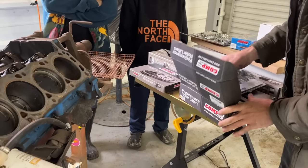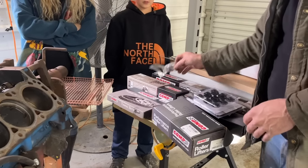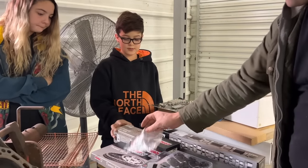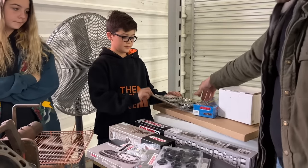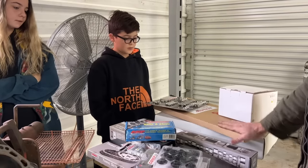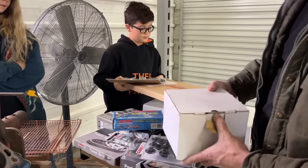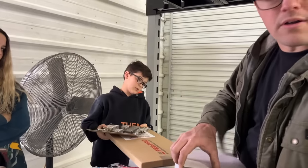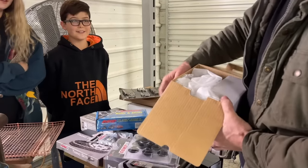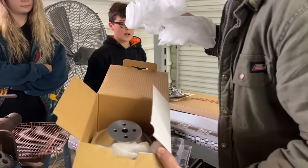All these parts, I will have the part numbers in the description. We also have a timing set, retainers and locks for this thing. We got a new set of valve springs. We have push rods for it. I went ahead and got a bolt kit for it too, new ARP head bolts. We got a gasket set. I got some pulleys from Scott Drake for this thing because we ruined the pulleys that were on the old 289. So we got some nice new aluminum pulleys for this thing that'll look a lot better than the old ones.